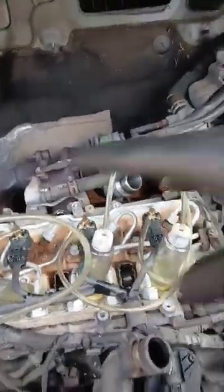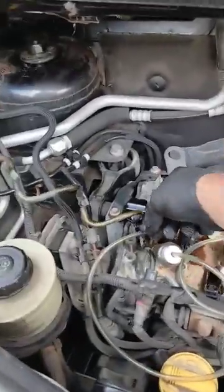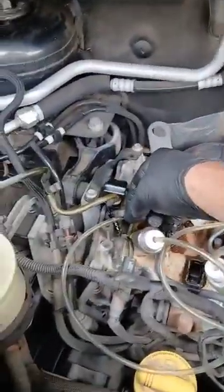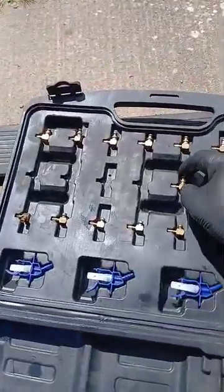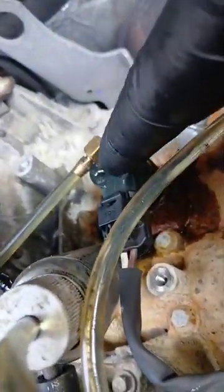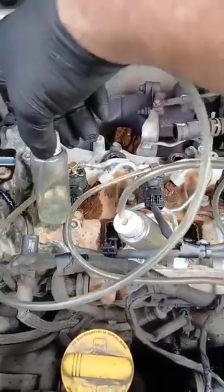They just come to the pipe — they're normally all joined together on a big spider and then these pipes get hard and then they're a nightmare. So what you do: take the leak-off pipe off your injectors, just pull that clip out, pull the leak-off pipe off, and I use blankers to stop the fuel coming out. Find which of the bits is right for you — on this one it happens to be number two. Fit them on top of the injector, put the clip back in, put the pipe on, put the tube into the bowl, and repeat for all four or if you've got six.